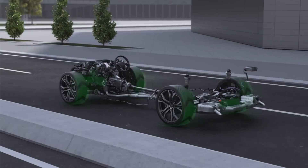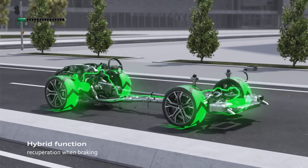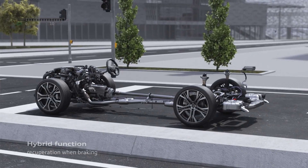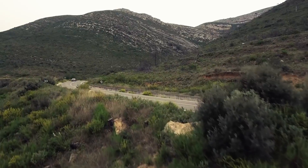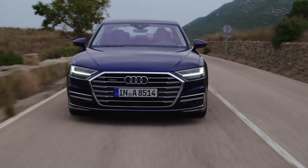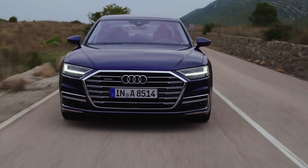When it comes to the drive, we did notice that the braking felt a little bit soft, since the mild hybrid engine will use this opportunity to recuperate some power. The real benefit of a mild hybrid system is that it saves on fuel: when you're in stop-start it shuts down the engine, when you're sailing it can disengage the transmission for 40 full seconds, and when you're braking you can recoup some of that energy. This was the driving moment that made me curious to learn more about the mild hybrid system, since the feedback on the pedal was noticeably electric.